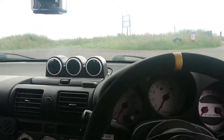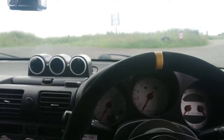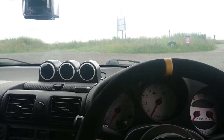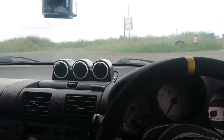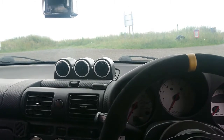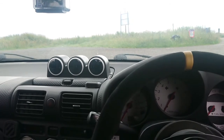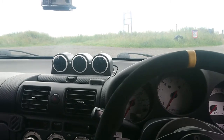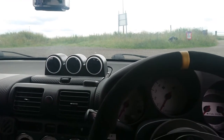With the 2ZZ motor that I've got to go in, I also have an ECU Master EMU Black to go in with that, so that'll be getting mapped properly. We'll be doing two-step, everything, a couple of different boost settings on that one. I've got some 1000cc injectors to go in with that, and a generic GT3076. So with the 2ZZ looking for over 400 horsepower, that will then potentially put me in transmission troubles, but you know, we'll see what we can do.